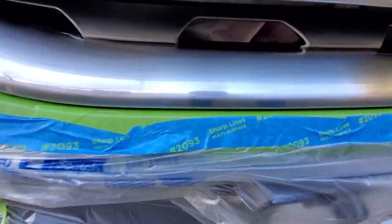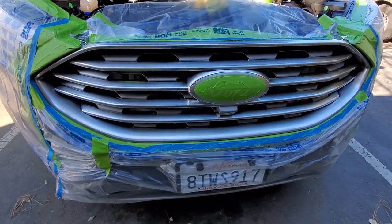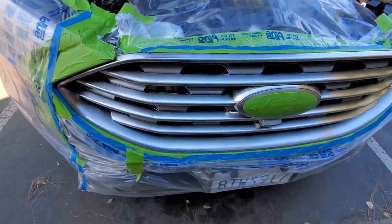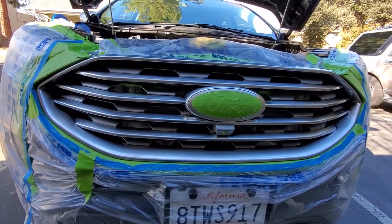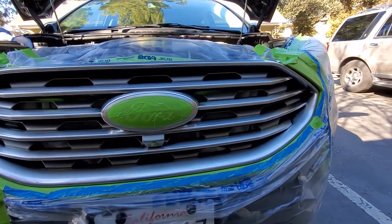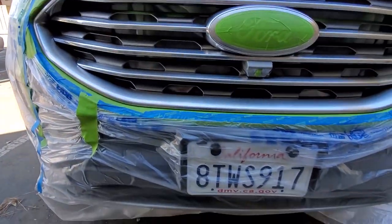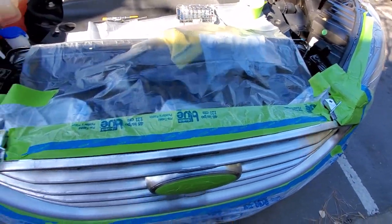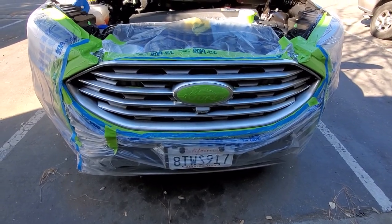The little plastic cover goes on top of that other tape so you don't paint your car. With that I put some primer and then paint. I'll show you how it goes once I primer it. There are many videos showing how to paint — you want a nice easy first coat and then subsequent coats a little bit heavier. This is not the right way to do it; this is just the way I did it, to save yourself a little time from pulling the whole thing apart.